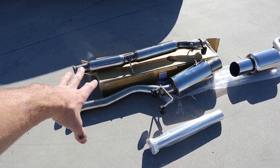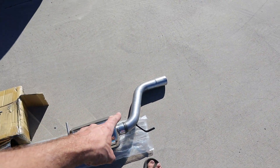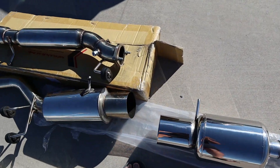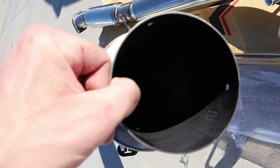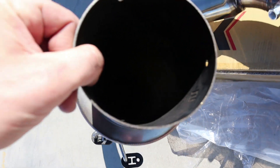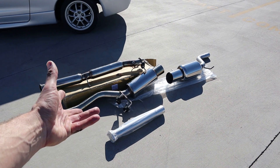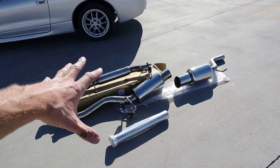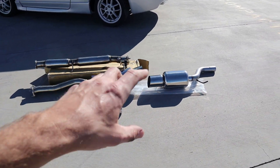That's the SRS can — no baffles inside there or anything, it's just a straight-through shot. All the pipe is three inches. This one is two and a half because it's made for the GS. But if you look at the inside of the SRS, that thing narrows down to way below three — two and a half, maybe less. So it might not be the perfect system if you're looking for maximum flow, but I'm looking more for aesthetics. Hate on me all you want — this is gonna look sick.